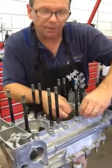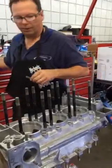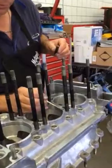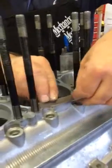Basically, we're just prepping the engine cases for reassembly. We're picking out all of the glue out of the cylinder head stud area, so there's no glue anywhere. And then after that, I spray WD-40 on these areas, and then I block them to make sure they're perfectly flat.